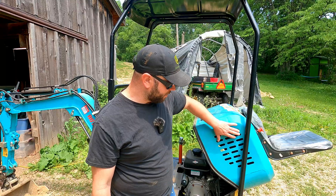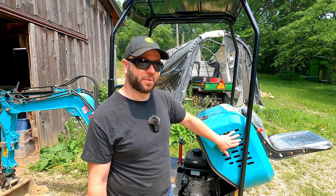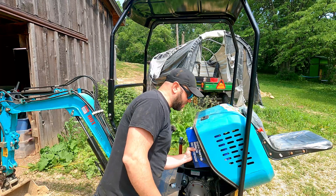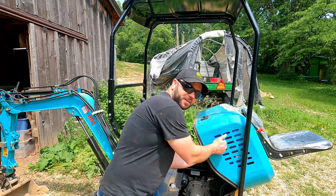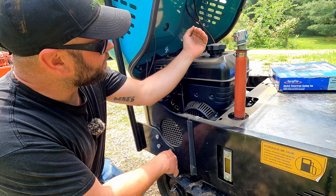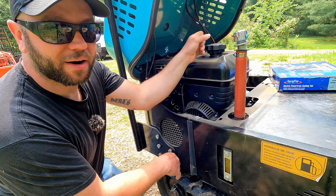If you were blowing through a radiator this thing would be 500 CFM. I think we'll be somewhere in between because we don't have a full open spot — we have all this kind of metal in between, but the slots are a lot bigger than the fins on a radiator. The plan is to mount it up underneath here on this side of the machine, with the fan installed to draw air through and blow the hot air out.